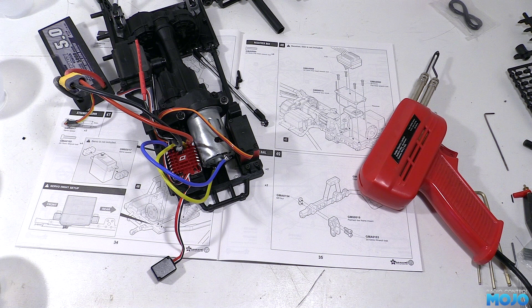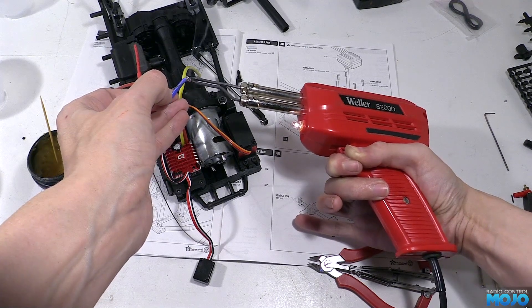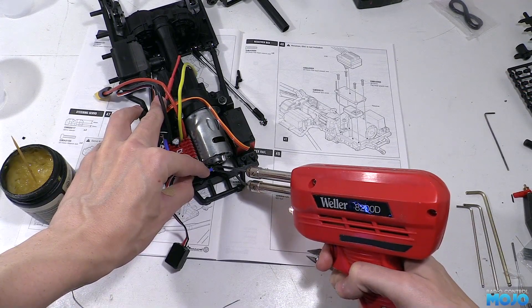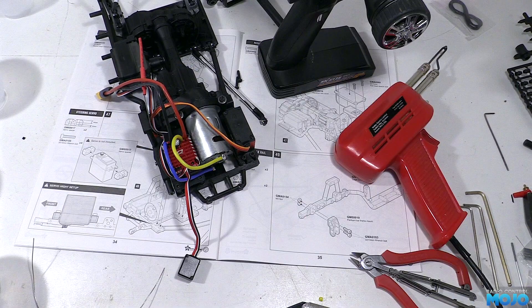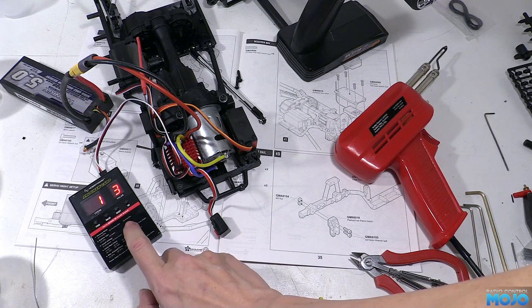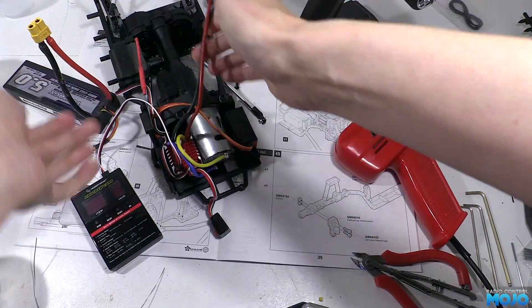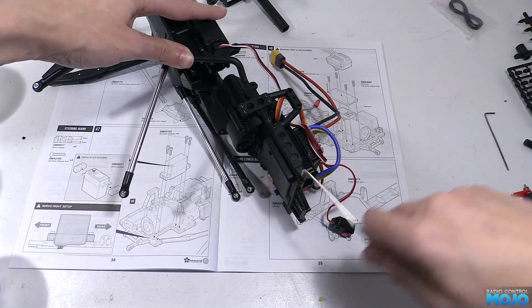In my case the transmitter was set correctly but the motor wires were reversed. I'd already desoldered them and shortened the blue wire before noticing I wasn't actually recording. I've tried to route the wires so they're going to stay neat and tidy once the rest of the cage is fitted. With both wires soldered it all looks fairly tidy. All that's left is to reset the ESC to forward brake reverse, which is option 3 for the running mode. When the truck's built it should be ready to run straight away — there are still settings to play with but it should drive with the current setup. The last thing is to refit the two screws to reattach the electronics tray to the chassis rail.